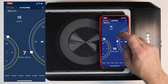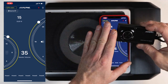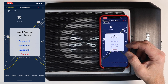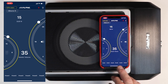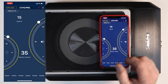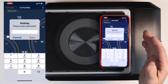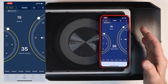On the main page you have a master volume control — it's a redundant clone of the physical knob, so you can hide the knob if you want. Subwoofer level control is next to that. At the top it says 'source': tap it to bring up high level, source A for aux or line level input, or source Bluetooth. Your presets are located across the bottom. Select 'pro user' and a pop-up will ask for a password — per the owner's manual on page six, the user password is 8888. Select 'sure' and that will unlock it.